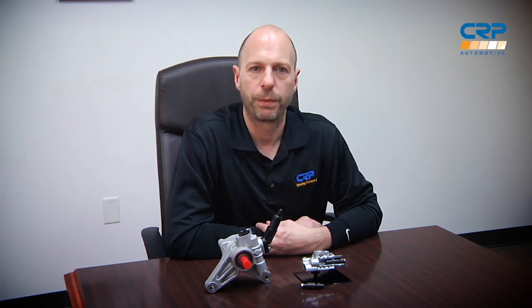The return pipe on the OE pump is also a common culprit of noise issues caused by air entering into the system. This problem leads to customer complaints and higher rates of returns. With remanufactured pumps, the pipe isn't typically supplied, so you would need to reuse the old return pipe and install a new O-ring. That process was difficult on this model pump and often leads to a pinched or cut O-ring that would cause air leaks.